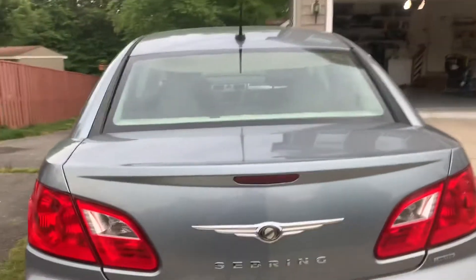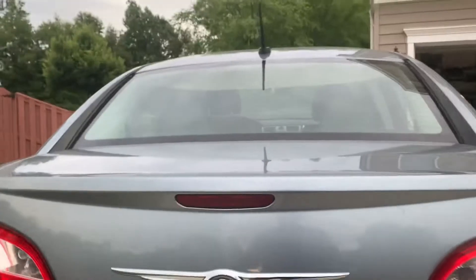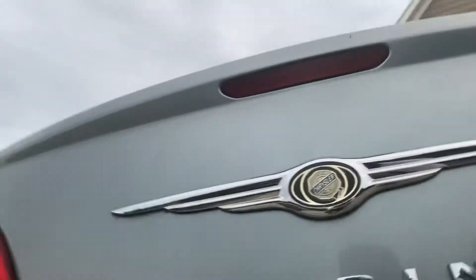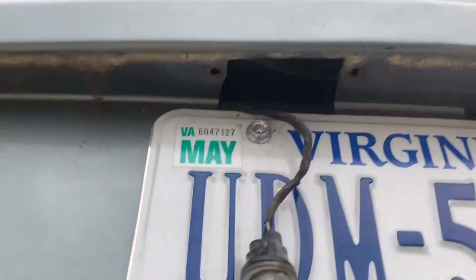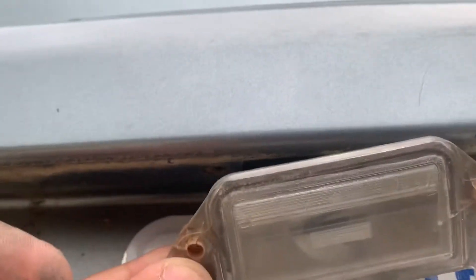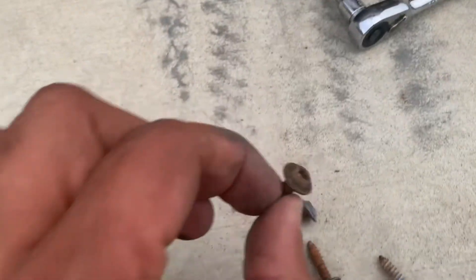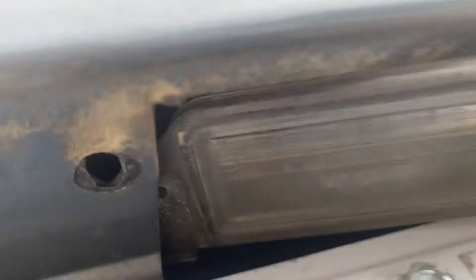Here's another video on a 2010 Chrysler, 2.4. I'm changing the taillight bulbs. For your taillights, you got two covers with two openings, and they are a Torx T25 screw.